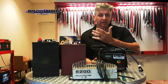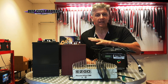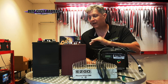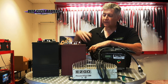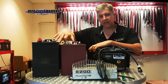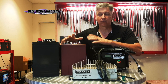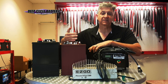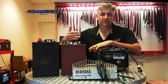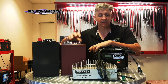People always ask us what happened to batteries that used to last long — they're just crap nowadays. They're not. Battery companies are doing a better job of making batteries. The grid that Trojan and Crown build is excellent compared to what Costco is putting out. The grid is everything, and these companies are using more expensive grid because it's probably one of the most expensive components to build in a battery. That's where your antimony lives — in the grid.